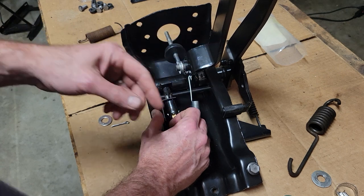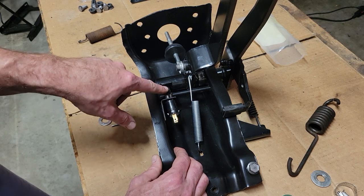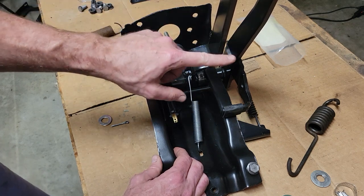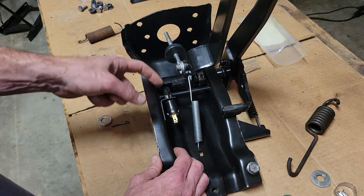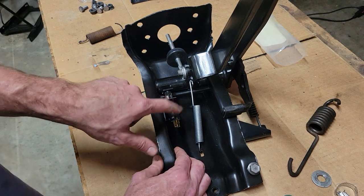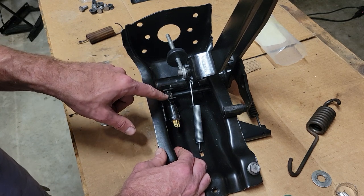Sorry, the video needs to be pulled back some. But anyway, the brake switch here is engaged. Again, it's all fine. You've taken out the play from the push rod when you push this brake pedal forward and you hold it there, except this is just snapped in there. That's not gonna hold it. You get this pushing back. Look at that. It just pushes it back. And this is a plastic piece right here. You don't necessarily want to use this as a backstop, even if it could hold right there.